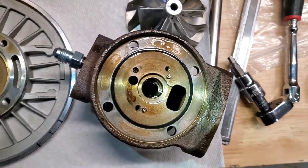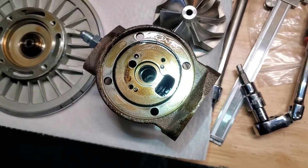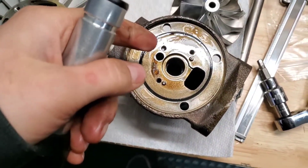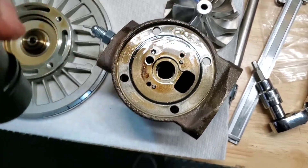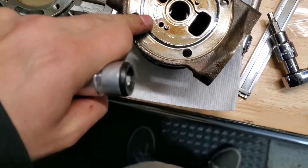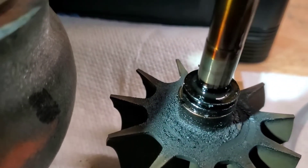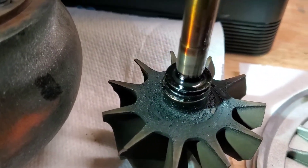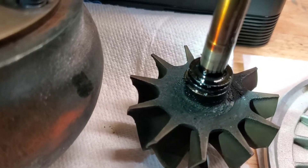Now we can get a better look at how this works. Here's the snap ring and one journal bearing — you can see all the way through to the other bearing. This entire section gets filled by oil, and there are two feeds that come down: one for the front and one for the rear bearing. I'm not going to change the carbon bearing out since they didn't give me a new one, and dealing with carbon is a pain. Here's the piston ring at the bottom that fails and leaks all the oil out — no wonder running 22 pounds of boost was enough to kill it.